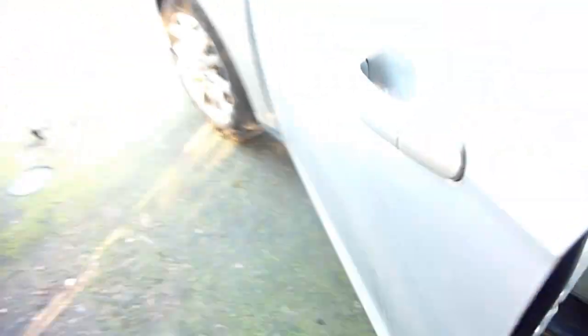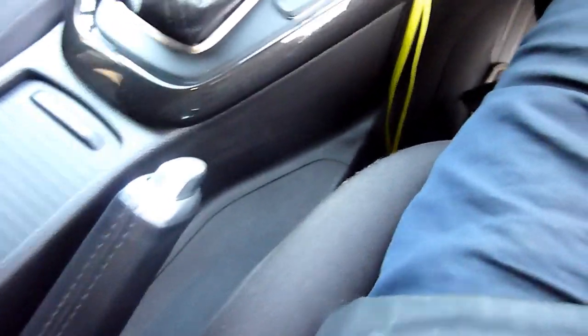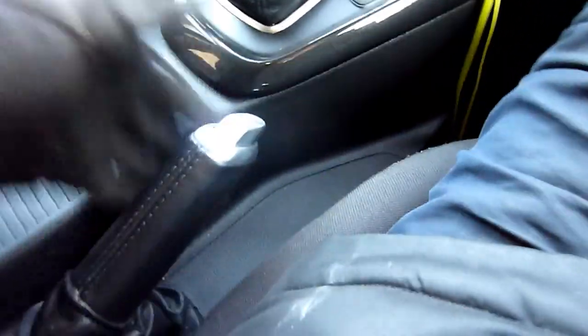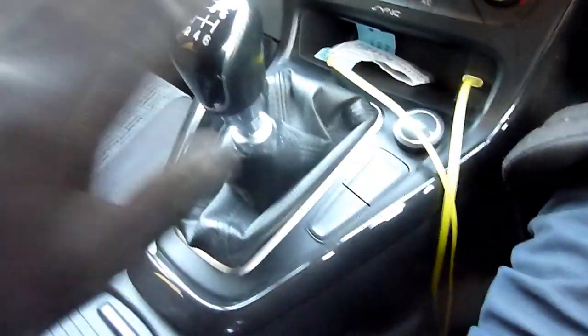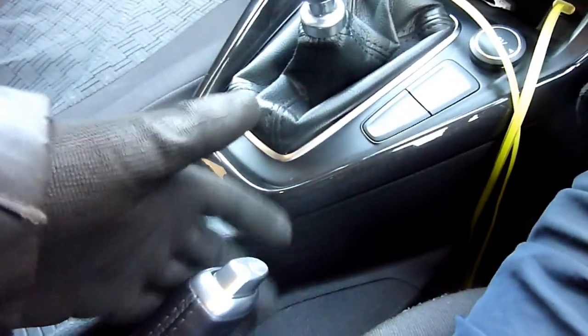Check the door handles work. Again, two weeks before, so you need plenty of time to fix anything that's wrong. Check the functionality of your parking brake — or handbrake as it's called here. Mine tends to slip a tiny bit on a hill. Take it out of gear and make sure it doesn't slip. If you're on a hill, keep it in gear as a backup, but the handbrake must hold on its own.